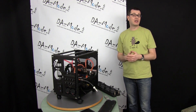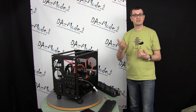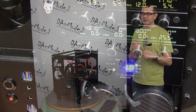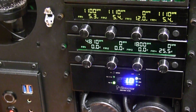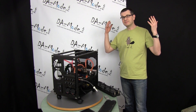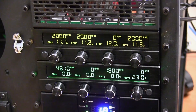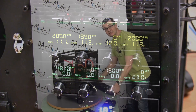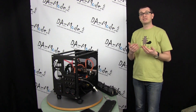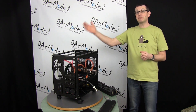Another thing I'm going to test is three different fan speeds, because everybody has their own comfort level. I usually run my fans around 1500 RPM — that's fine for me for noise and performance. But I know a lot of people like really low speeds, so we'll also test 1100 RPM. For the high-performance crowd we'll run fans at 2000 RPM as well. The more air we push through, the better results we should get, and we'll see what kind of temperature differences we get.